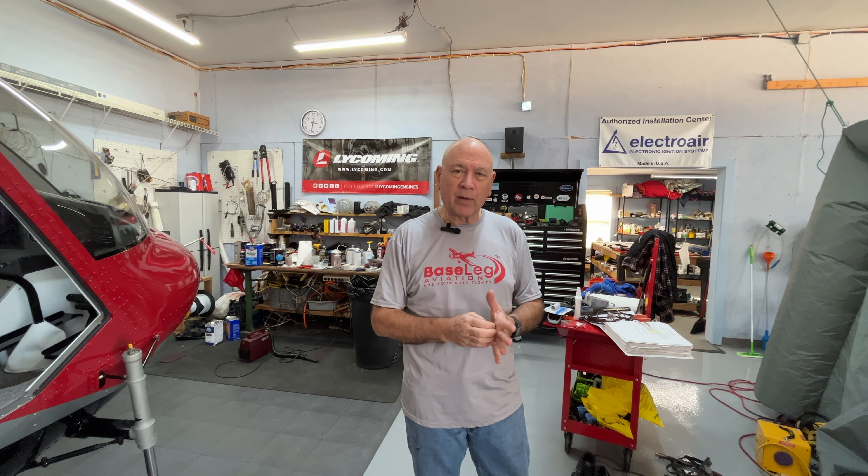Our neighbor, Steve Villeen — a really neat guy — he's got a couple of airplanes, one of which is a Champ, and decided it needed to be recovered because it's been 54 years. Lucky for him, he's another guy who said he wants his guardian angel. When he took the covering off, the cable was actually routed from one of the pulleys around a tube as opposed to directly up to the next pulley. So for 54 years that cable's been chafing on a structural tube on the frame in that Champ. Really, really poor workmanship there.